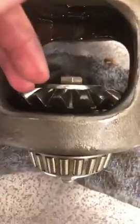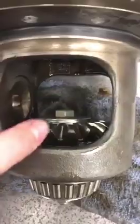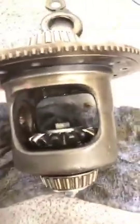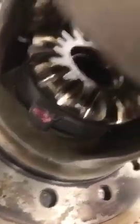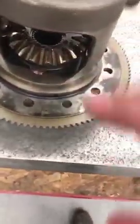This one's clamped down - I've got it tightened up and all it's doing is putting pressure against that spring washer, giving me more room to work in here when I want to drop in my spider gears. Now I'll stick this thing on end, rebuild this clutch pack real quick, and then drop it in the same way with the bolt facing this way. Dropping in the left side clutch pack - all you're doing is lining those clips up and dropping it down in. Now I'll put the bolt through and clamp that side so I can roll in my spider gears.